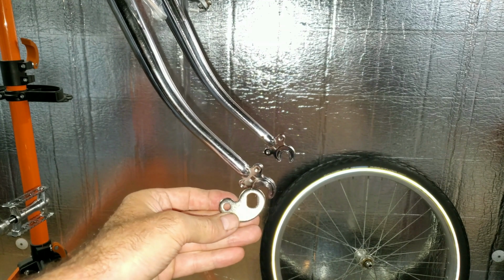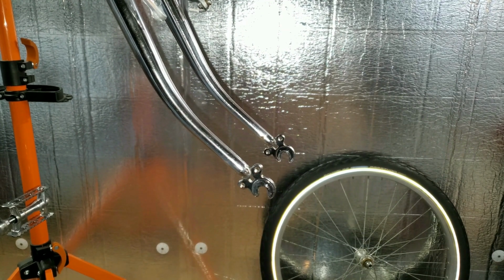Apparently a 12 millimeter axle is what I'm going to be getting, because I'm going to run a 500 watt. They got 1,000 watts too that run about 30 miles an hour and they're gearless, and a 500 watt that's got gears in it, and that's the one I'm going to run. Apparently it's more efficient and it's slower, and well, it's not black. So that's the biggest reason why I got it, because everything now is black, because apparently China, the people that make all of this stuff, got no class, no style, and no chrome.